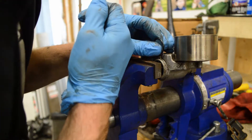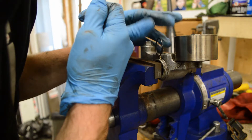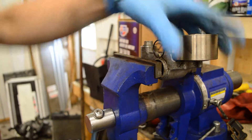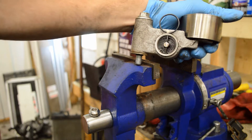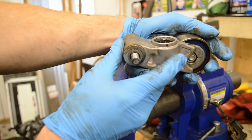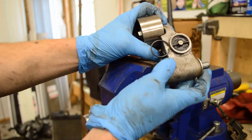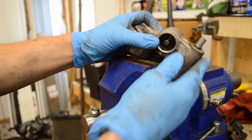If not, you can experience it and go buy a new tensioner. Once you get it in there, it just goes right in nice and easy — I could literally just drop it. Then once we get the back hole lined up, bada bing. The piston is now collapsed in and held in place by what we call the grenade pin. That's essentially how you reset your timing chain tensioner or timing belt tensioner.